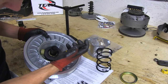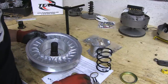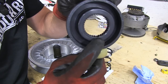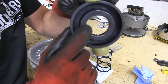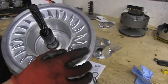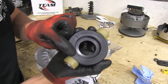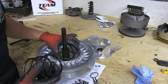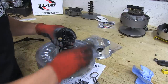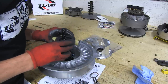Take your pliers. Now you need to take note of this little notch right here when you're installing this — otherwise these teeth won't align. There are a couple of alignment marks on here to make your life a little easier. There's an X right here, and there's an X on here. You have to make sure you align those, and the little notch on that.